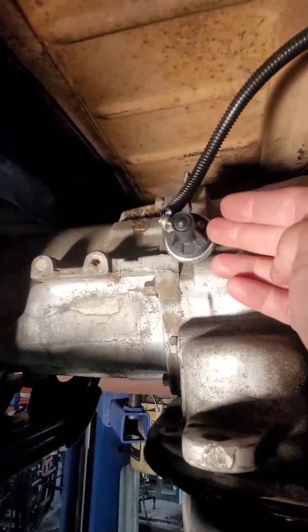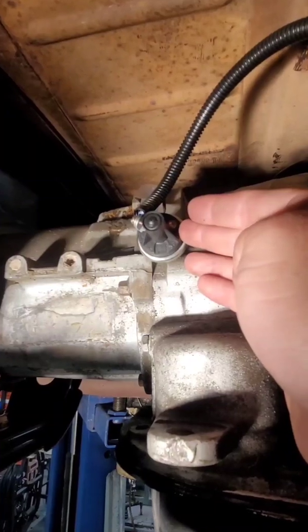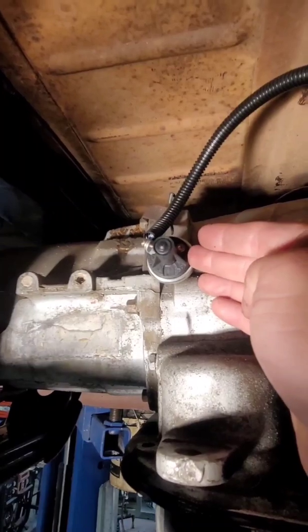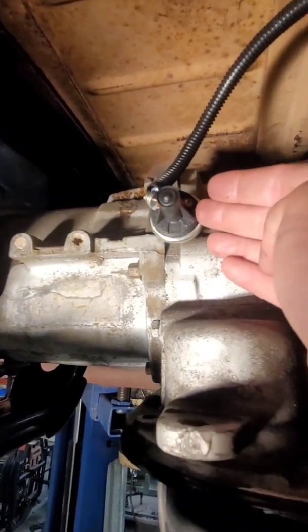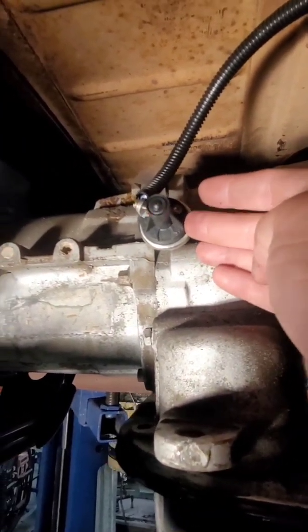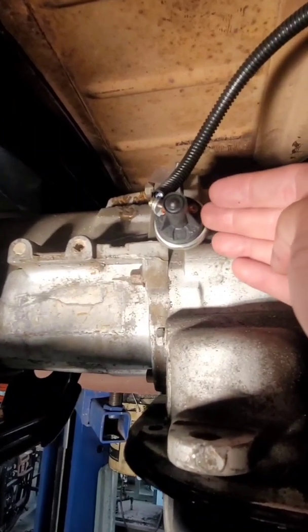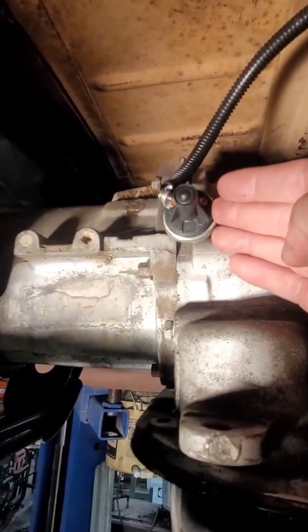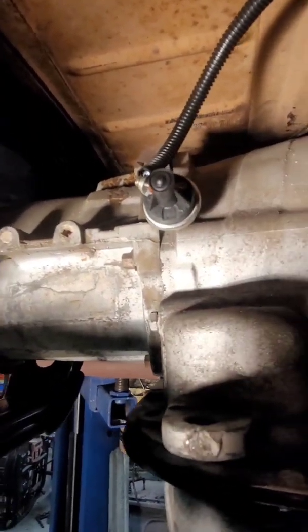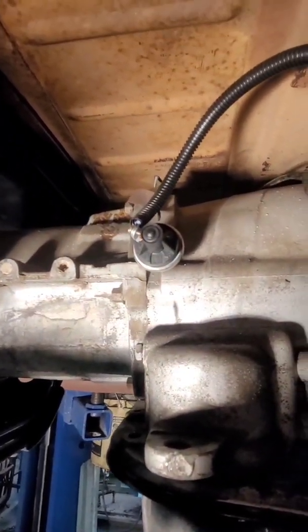As far as the pressure goes, that'll depend on your rear wheel size. The PATC kit has very good instructions that explain this well — I recommend reading over that if you're considering doing this. You can set it to whatever pressure you like. I believe mine is set around 50 PSI if I remember correctly. There are instructions on which way you need to turn the screw to adjust the pressure.